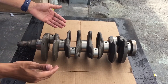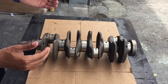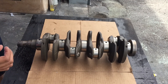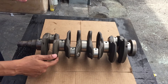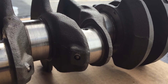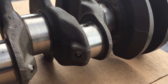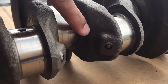One of the first questions you want to ask is: do you have a forged or a cast iron? The easiest way to identify if you have a forged or cast would be the wide parting line. There are also a few things that can be done to improve the crankshaft — one being knife edging, which is removing any excess material, and in some cases you can add shot peening as well. You can also chamfer the oil holes, which is essentially a countersink, and that will improve oil flow throughout the entire system. You can observe that this is a forged crank by the wide parting line here.